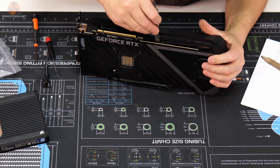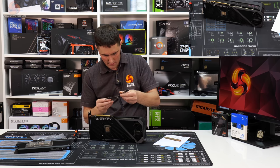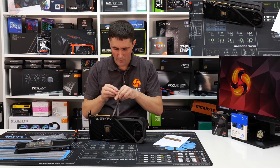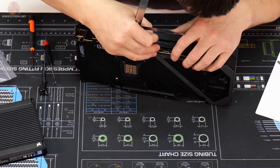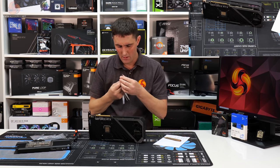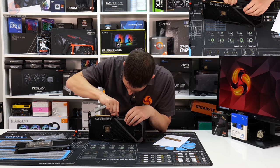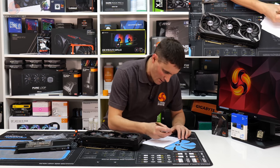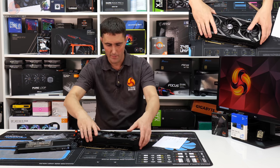And there's a bit of a gap as well there. So to get 2.5, I'm just going to stick with the ones I already had, plus a 0.2 and a 0.3. Try and hold those tight and put them down. That looks close, very close to going in. So yeah, I'd say 2.5mm for the inductors on the front of the card. So we'll try 2.5mm pads on there.